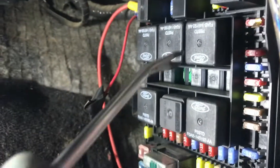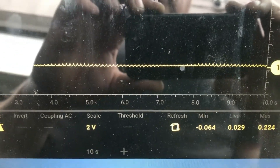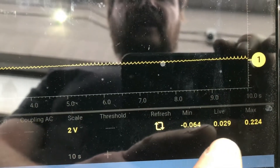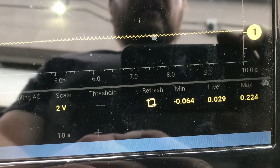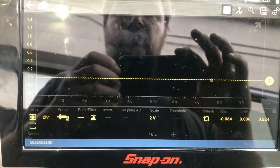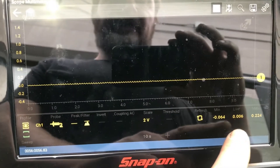Going back to identify this relay — it's hardwired onto the circuit board. Then something clicked off. We lost about 50 milliamps. After re-zeroing the amp clamp, it wasn't any better — still around 300 milliamps — but then I came back and it had dropped to next to nothing. It's possible that whatever was tied in was keeping the accessory delay circuit open.